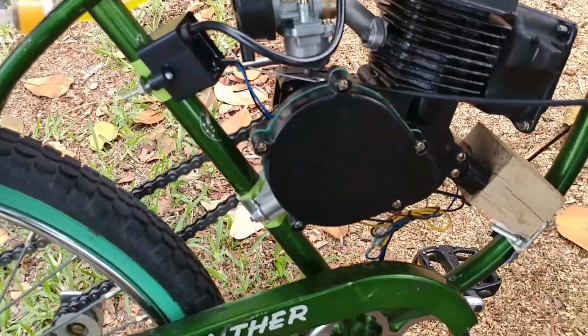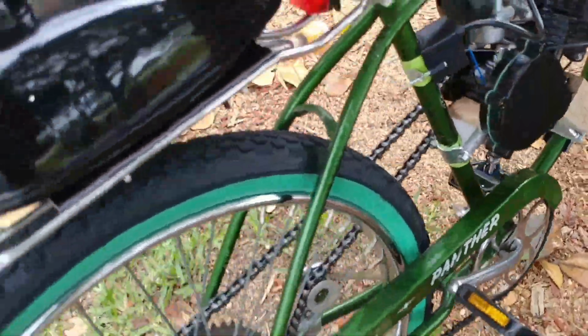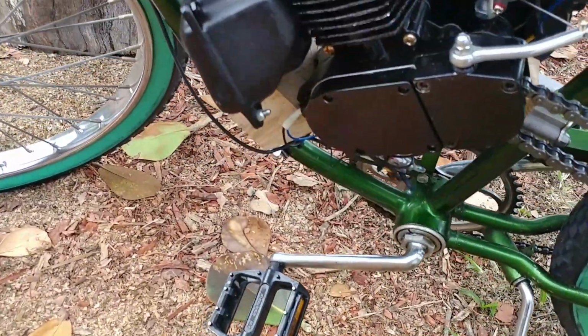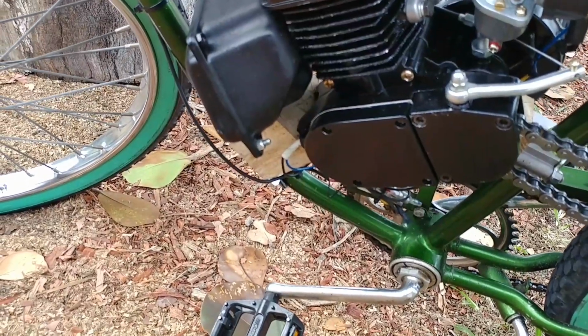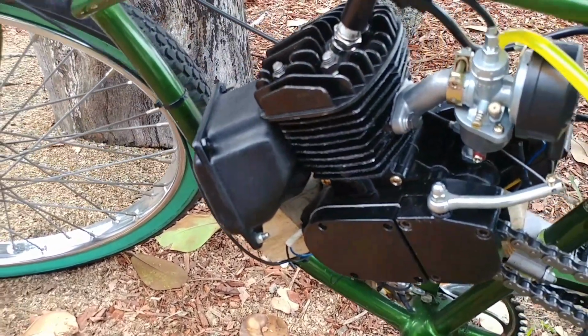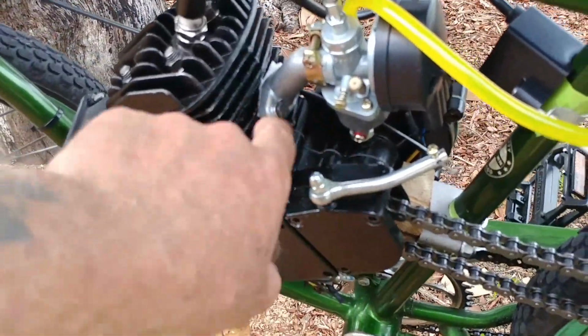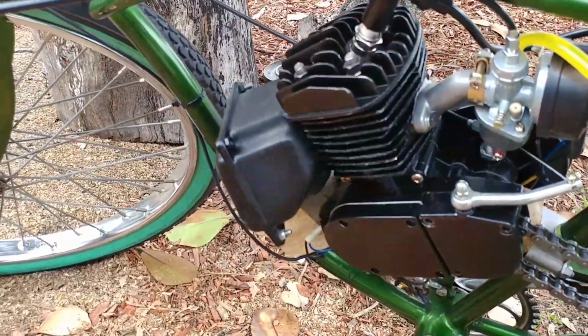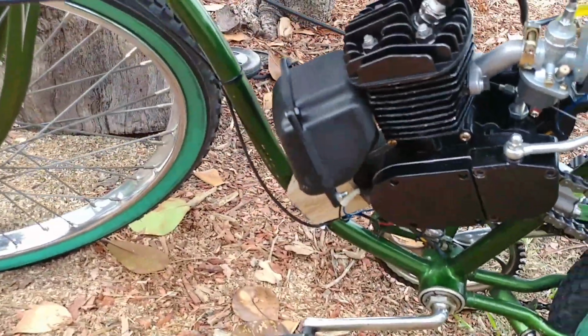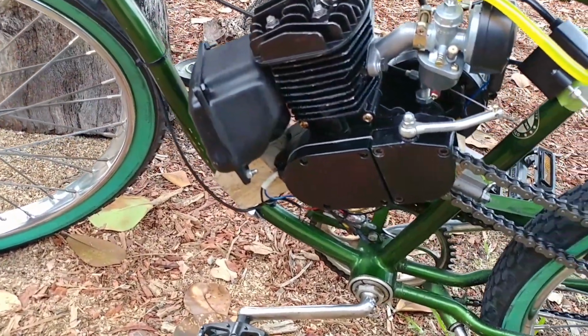The CDI was way out of whack too when I took that off. It was completely adjusted to one side and it was shaving metal off, and the other side had a huge gap. So I had a zero gap on one side and a huge gap on the other. And I ran a tap through all the threads. Everything was pretty much stripping on me. I had to put a Heli-Coil on the exhaust right off the bat too. I pulled the threads right out of that sucker.